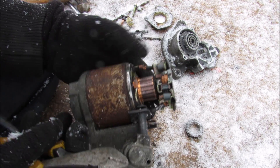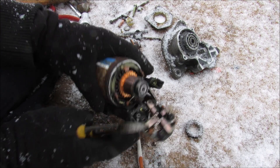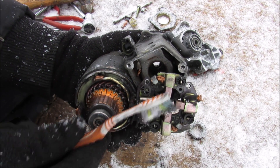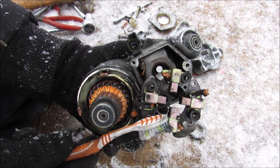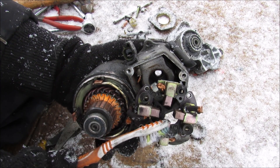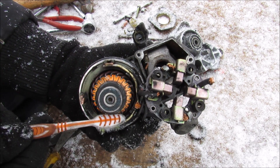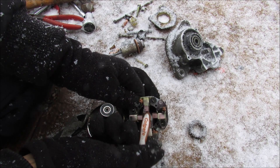With the brushes up off of the armature I'm going to cut this wire here just to release it. If you take a closer look at these brushes, they all have this spiral kind of spring that pushes the brush up against the armature so it always maintains contact. That's where we come to the second most worn-out part in any starter motor — it's these brushes. Sometimes these brushes can actually mechanically wear out just due to friction against the armature, and then they'll start losing contact so your coil will stop spinning. You can see that springy action as I push against this brush here.